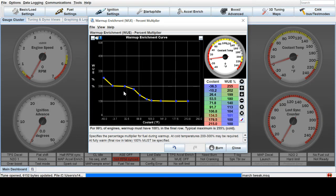What I've done to dial in this curve is take the motor outside when it's like 30 degrees, try starting it up, manipulate the values around, and do a couple startups to find where it likes it best. Then as it warms up, I'll adjust it — see if leaving it higher starts better than lower — and move them around until I find kind of an even ground.